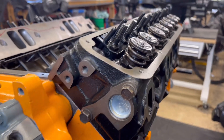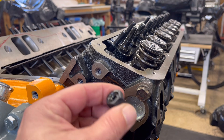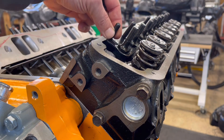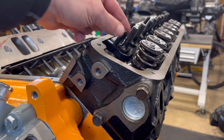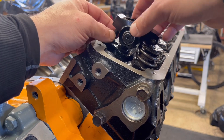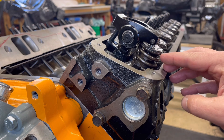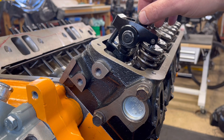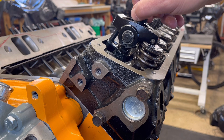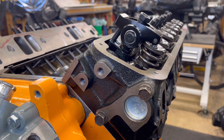The next step is pretty simple. You have your rocker arm and your rocker arm stud nut, and you can see the poly lock in there. First, make sure your push rod is in the center of the lifter. Put your rocker arm in — make sure it goes into the cup — and line up the roller in the center of the tip of the valve stem. From there, turn it until it's just snug. You don't want to go further down yet because that starts setting preload. It should be just finger tight snug. Make sure you can still rotate the push rod around. That's where you'll start adjusting it down and setting preload.